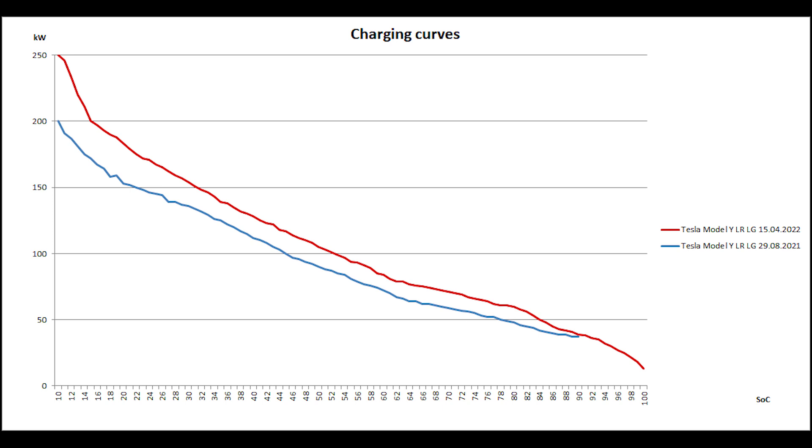Towards the very end it seems to almost converge with the blue line, but this is way more pleasant. Ideally you want to have an e-tron flat charging curve, but how healthy is it? I think this kind of charging curve is healthy. I should point out that when I did the 1000 kilometer challenge, I didn't really hit 250 kilowatt — actually never hit 250 — but I did hit around 200-220 kilowatt many times. That initial jolt past 200 kilowatt really helps when you just want to fill up the battery fast. You still get a nice and flat curve even up to 50%, so I'll take it.